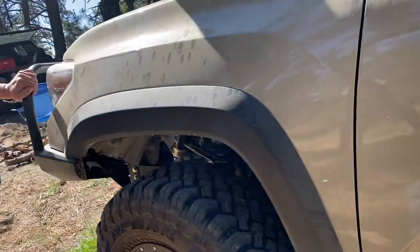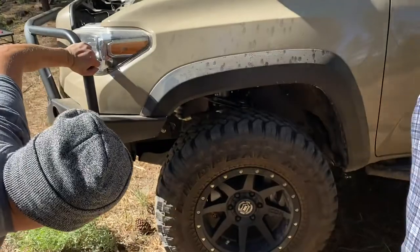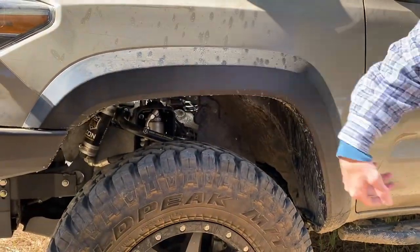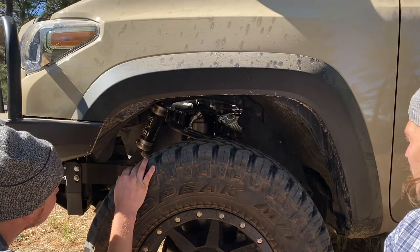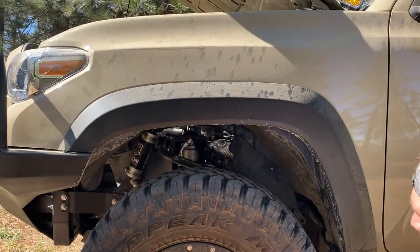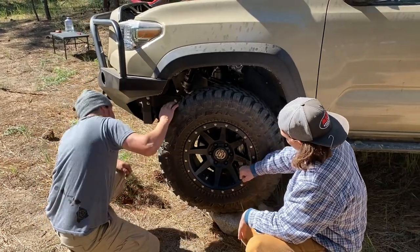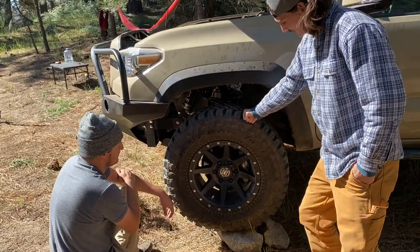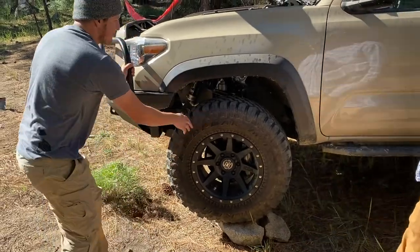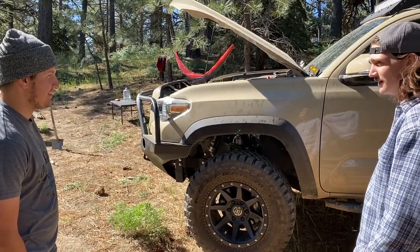What kind of suspension are you running? For suspension, I'm running an Icon kind of a chopped-up kit — pretty equivalent to like stage nine. They're two-and-a-half-inch reservoirs with an adjuster valve, CDC — compression dampening controller. Recently I took the Icon springs off the coilovers and went with 14-inch by 700-pound Eibach springs. And these are the Icon rebound rims. Those are fitted with the Falken Wildpeak mud tires. A lot of people are using these tires — do you like them? I love them. I can pretty much keep it in two-wheel drive everywhere I go.